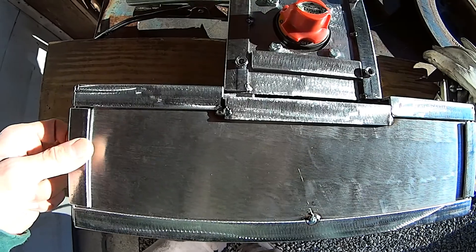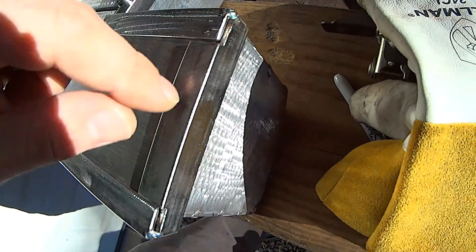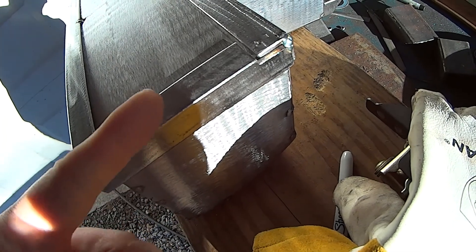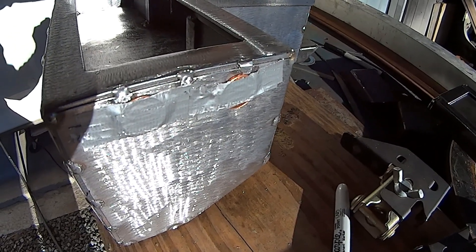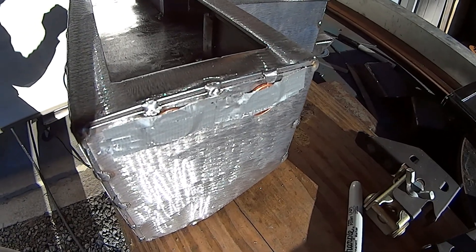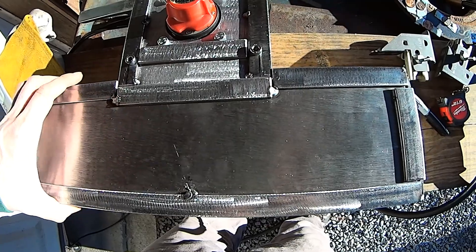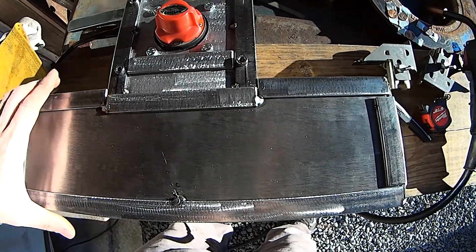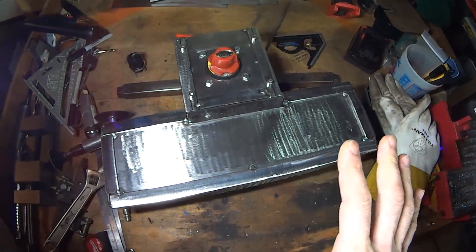This is on here but it's too tight — two steps forward, one step back. I'm going to cut these free again. I'm going to tape a couple of pennies to the side of this spacer to keep it away from the sheet metal a little bit more. Did the same thing on the other side. Now I'll put the frame back on, weld it up again, and when I take the pennies off we'll see how it feels. That gave me a little bit of freedom of movement left to right, so I can grind my tacks and get even more space — enough room when you paint it that it doesn't drag the lip.